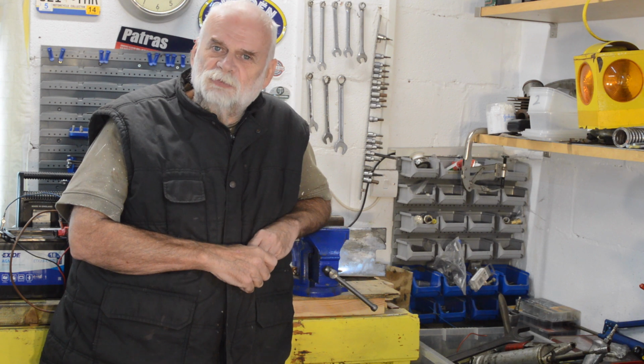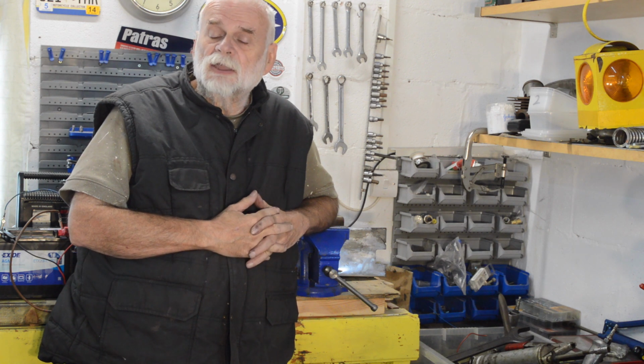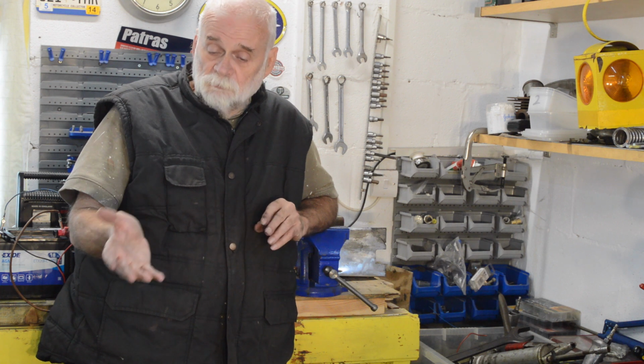quick update on the 2CV, and it's not good news. Now, the head I put the guides in, which is another video on the channel, have a quick look, came off an engine which I had taken to Greece in this car, and it had burnt oil. In fact, it had smoked quite a bit by the end. And a good friend in Belgrade sorted out having new piston rings fitted because we thought that was the problem. It wasn't, it kept smoking.